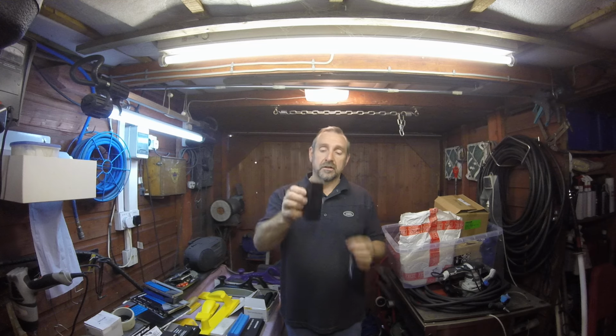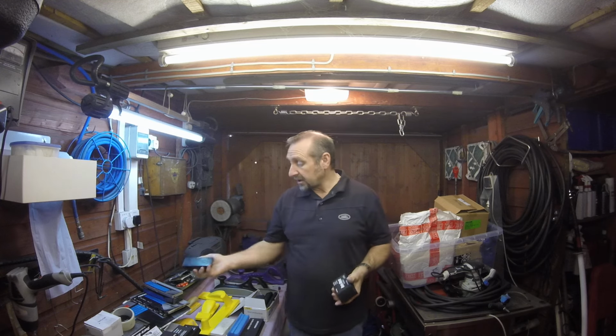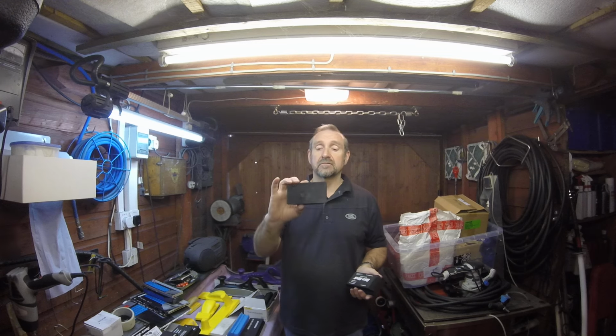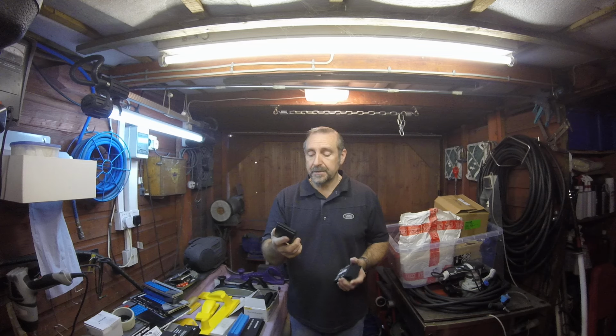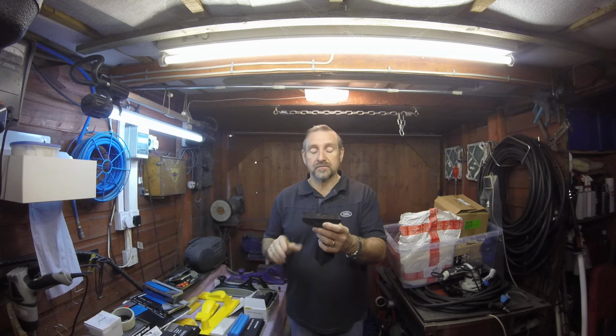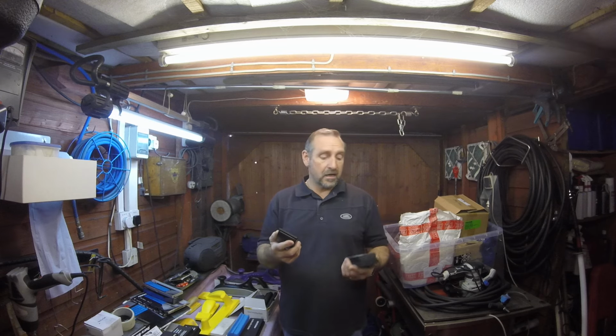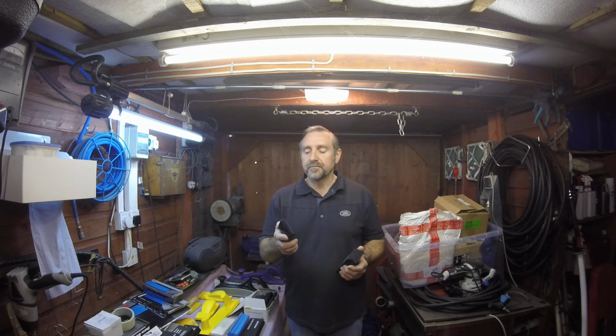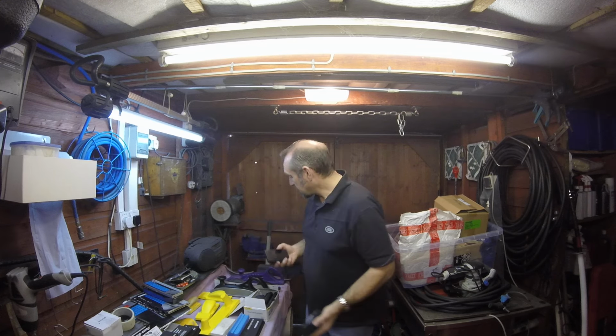These are great for trapping a third of a sheet of wet and dry. So if you were doing some wet sanding, say on a primer using a P600 or P800, whichever you were using at the time, these blocks are great. Once again, not very good for rubbing over a repair because the block is very small. So if you were just flatting down a primer after all the repairing's been done, you put your 2 or 3 coats of high build primer on, you've guide coated it with an aerosol type guide coat if you're going to do it wet, these are great, these are still usable, they're fine.